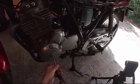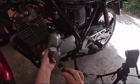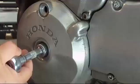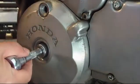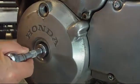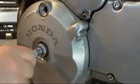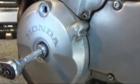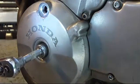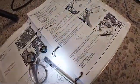Next I need to remove these covers so I can turn the crank and see the timing mark. I also need to make sure it's, so as I turn it we can see the valve gear. There's the exhaust valve moving. That's up. Torch. We're near top dead center now with the valves closed. Just turn it slowly. And there's a line with a T that looks like that.